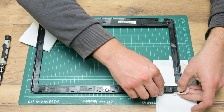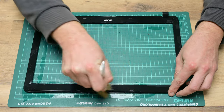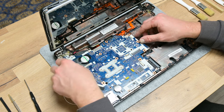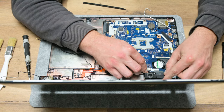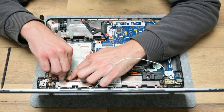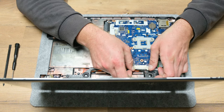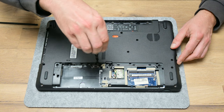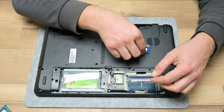The bezel is broken diagonally on both sides, but it's easily fixable with strong glue and a little patience. After fixing the bezel, I moved to assemble the laptop and do some upgrades. The CPU upgrade I had done before — instead of the Intel Pentium B960, I went with an Intel i7-3630QM. The chipset supports this CPU and there is no 30-minute limit, so it's fully supported. While assembling, I also upgraded the RAM from 4GB to 8GB total, replaced the mechanical disk with an SSD, and got a new keyboard for the laptop.